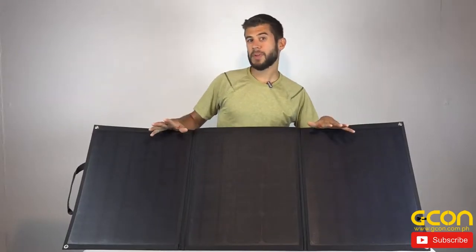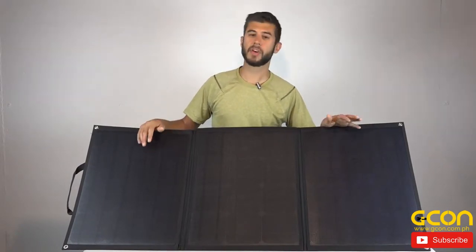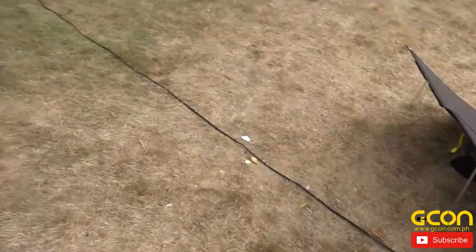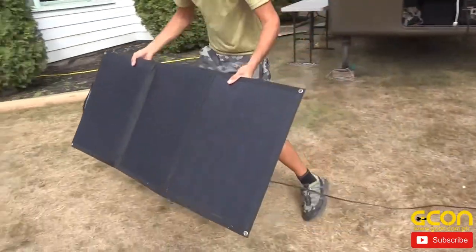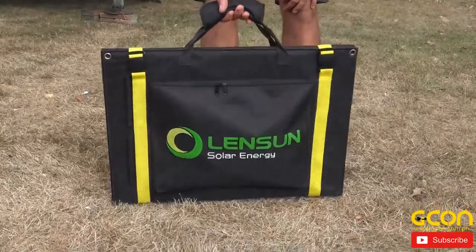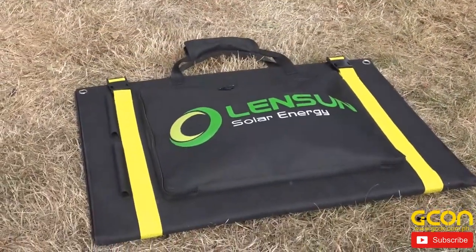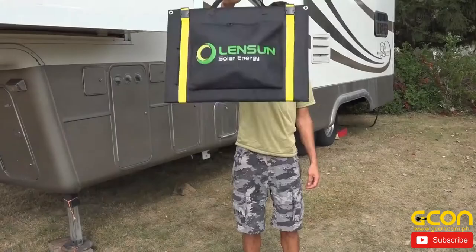We've been running these panels for a couple of weeks off-grid and noticed they drastically improved our battery run time. We have 200 amp-hour 12-volt batteries in our RV and can typically go about two days running lights, computers off inverters, etc. With these panels that about doubled — we were able to go about four days. If you're a lighter user, 100 watts of solar might be just enough to keep you topped off for running your lights and pump. I absolutely love the weight and size of these panels — they are so portable — and the flexibility and how easy they are to store. They take up hardly any space; we keep them in our basement right next to our generator. Weight is also an issue in a lot of RVs, and being so lightweight it's super nice.